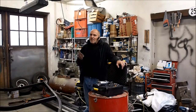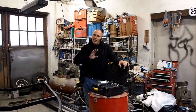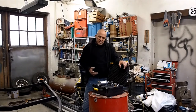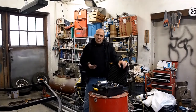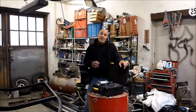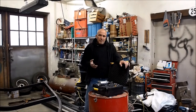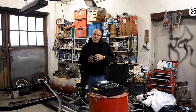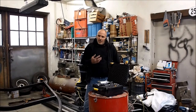flakes. But be careful if you paint the side panel and you put too much on, you get these runs. On the metal flake paint job, the runs are not that much of an issue because you have to sand anyway. But you want to avoid that, obviously. So normally 1.4 nozzle, no thinner, so it builds up a little bit thicker, and then you put it on.